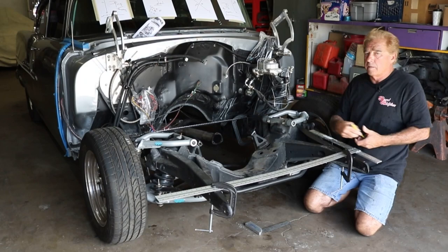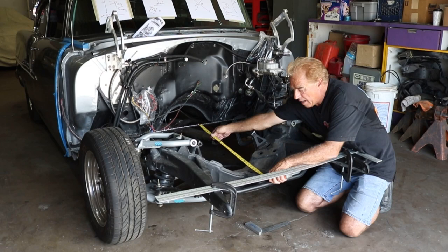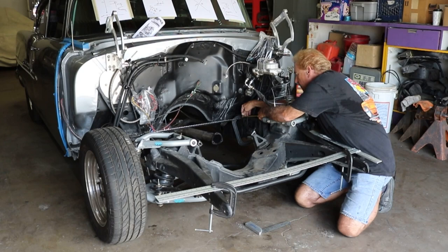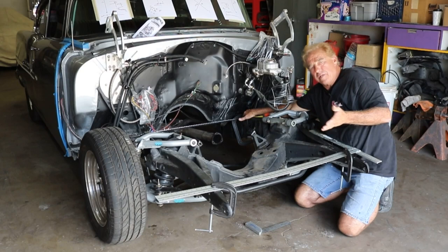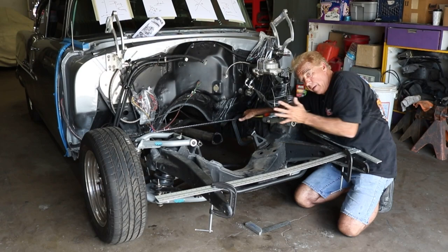Having that information, we're going to use the Jim Meyer measurements. We're going to use this reference to our core support center, which they call out at 32 and a quarter, and we're about 3 eighths of an inch off there — obviously because this is a damaged frame. Then what they want us to do is pull from that measurement, from this bar right here, from the back of the body mount, forward 4 inches. Using a square level to the floor, marked at 90 degrees on the inside and outside, cutting it using a Sawzall — we usually like to use cut-off wheels for a nice clean cut. But we're going to add that 3 eighths of an inch difference, so we're going to go 4 and 3 eighths. This way we'll be able to adjust it because we know we have some damage here.